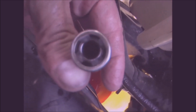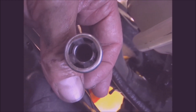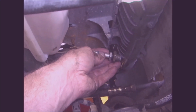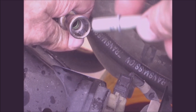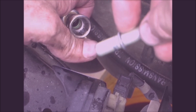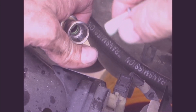Here's what that hose fitting looks like. You can see the four spring clips in there, and they have to be pushed open to slide off the fitting on the radiator. Since I'm replacing the radiator anyway, I removed the fitting to give you a better idea how to disconnect this. When the hose is pressed onto this fitting, these spring clips go over this ring and they lock on this side. So when you're pushing that tool in here, it forces those spring clips open so they can go over this ring.